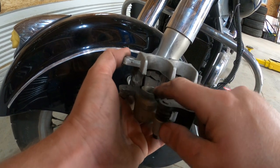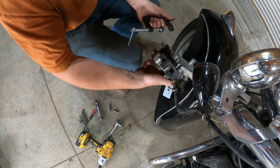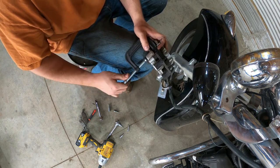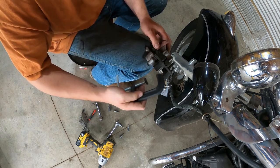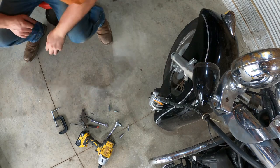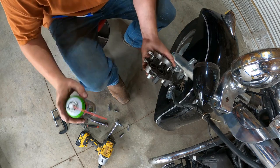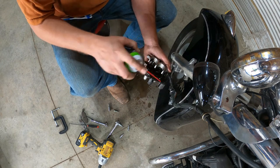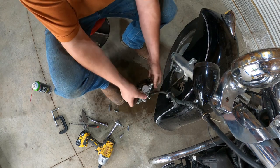All right, now I'm assuming it's like a car, we gotta depress these, so let's get a clamp. Okay, so we're gonna grab this. We're just gonna push this back a little bit. Probably don't need too awfully far because these pads are pretty thick. All easy so far. All right, so now I'm just gonna use some brake clean and a toothbrush. We're just gonna try and clean all this up a little bit. Get all the grime and nastiness off of it. Okay, I'm gonna let that dry for a second.